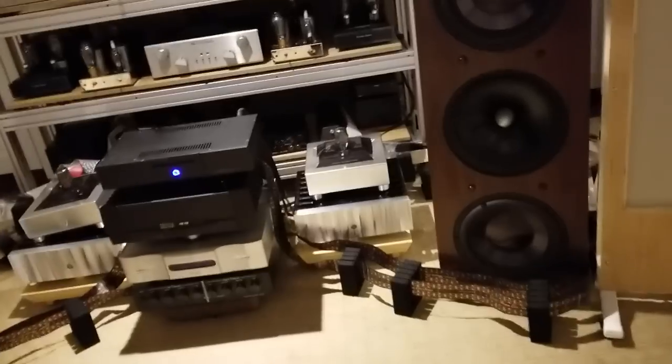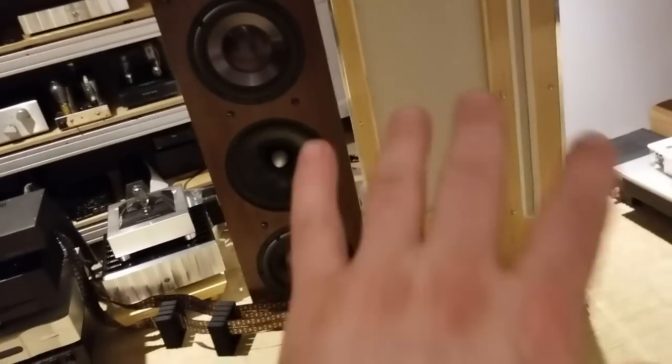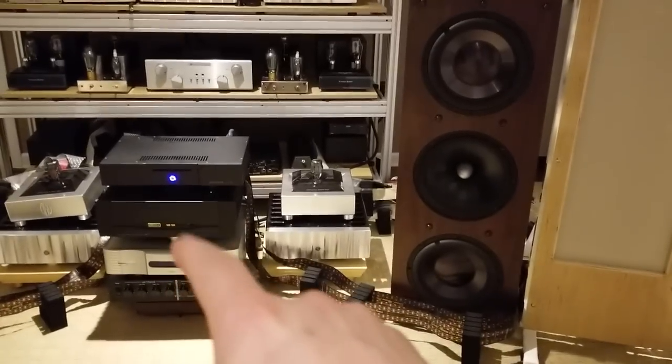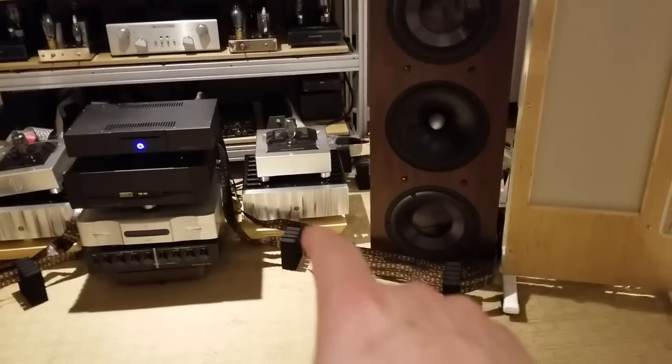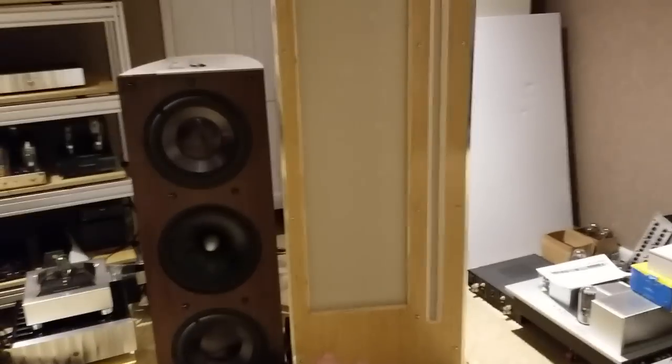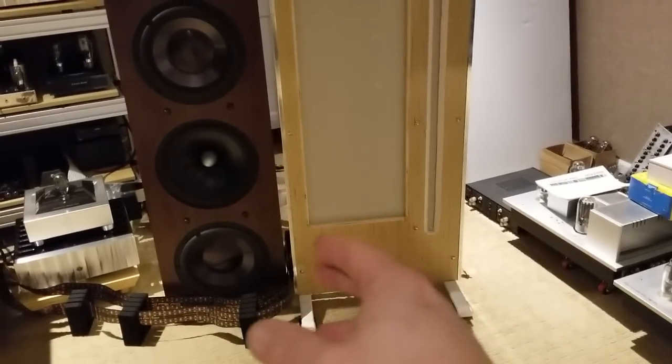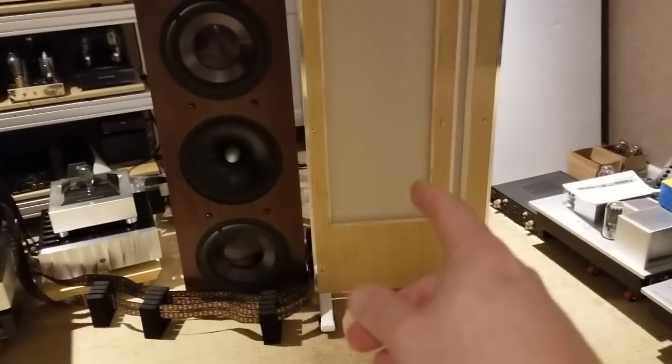What that means — I'll try and do this in a nutshell — everybody knows that you've got speakers, right? You've got your speakers, this is a sub, separate speaker and then sub cabinet. These are MagnaPan 3.7s that are the most beautiful Maggies you've ever seen because they've got my name on them. But I'm playing with you — I just like to tease MagnaPan a little bit. So what this is: you've got your source, preamp and stuff, it comes over to the amp, and then your amplifier makes it louder and sends it over to the speaker. And then in the back of the speaker — because this is a three-way — it's got a woofer, a mid-range, and a tweeter. There's something inside, a bunch of capacitors, resistors, and inductors that divide up the frequency: the lows go to the woofer, the mids go to the mid-range, the highs go to the tweeter.